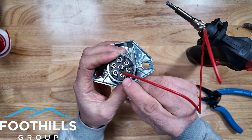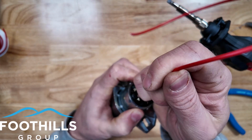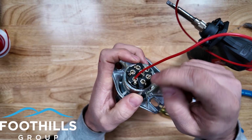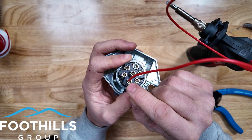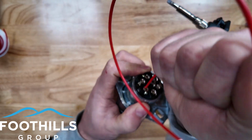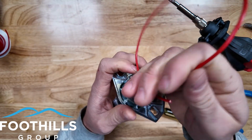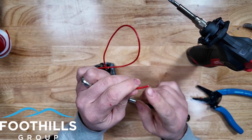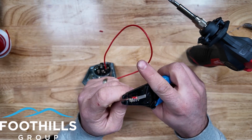What I find this does is it does bite at the wire, but sometimes you can find that the wire ends up being squished around the screw depending on the quality of your screw terminal and just really how good the screw is. Sometimes they're pretty soft screws and the wire seems to pull away. Now this is going to hold up a 10-pound pull test, no problem. So as long as you screw them in tight and then give a tug test, that would work just fine.